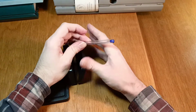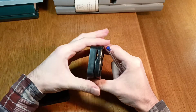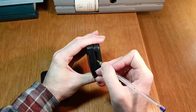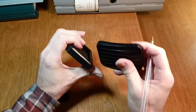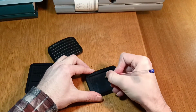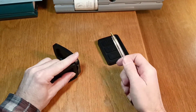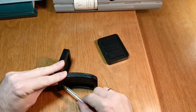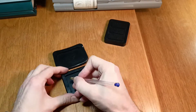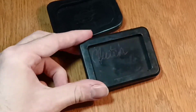You can agree or disagree, but I think we should be able to make this cut-out ourselves. Using the old correct rubber part, we can adapt the new one — mark with a pen the place on the rubber cover where we need to make the cut-out. We adapt this part for the brake pedal, and I write on this part that it is for brakes. Now we mark with a pen where we need to make the cut-out on the part for the clutch pedal. The parts for the clutch pedal and for the brake pedal are completely different, so write what each one is for so as not to confuse them.